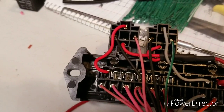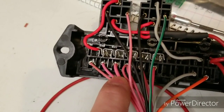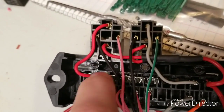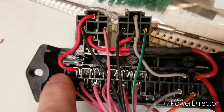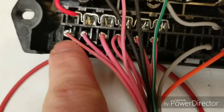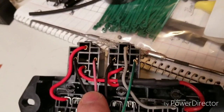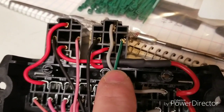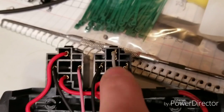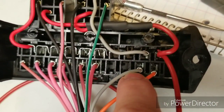Through each fuse, power gets sent out to one of various components. For example, this one is injectors one and three and the O2 sensor, the next one is the MAP sensor and PCM. I went ahead and did it this way so I wouldn't have to daisy-chain wires — I only need one wire to power all these points, then each fuse carries power through to the pink wires. That's activated only when the ignition hot is on. The other relay — the fuel pump relay — is triggered by the PCM. When the PCM commands it, power goes out through this gray wire, down to this fuse pin location, through the fuse, and out to the fuel pump.